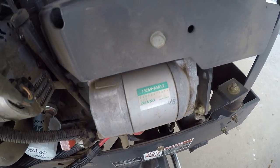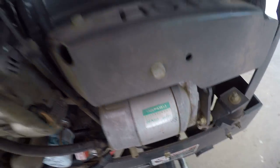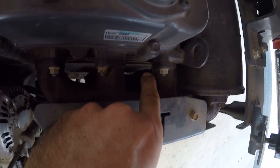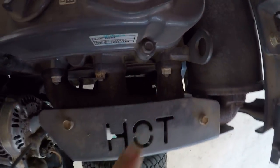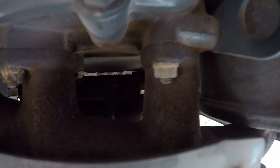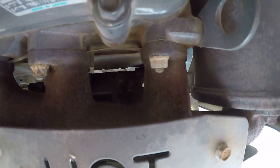If you wanted to try tapping the starter and thought that was your problem, open up the hood. You can stick something right in between the front and the middle — sorry for the poor lighting — but that gives you access to the starter so you could tap it a little bit.